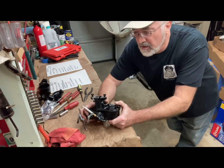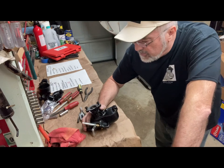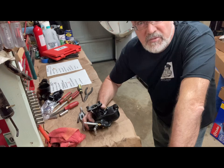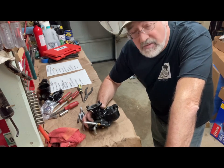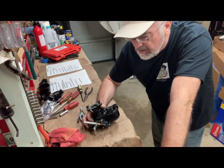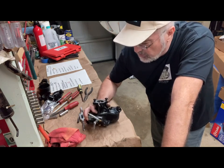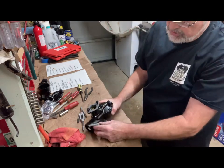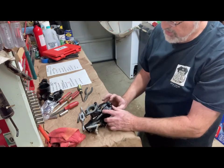And I'm still gonna work on the Holley. It has some stripped threads that I have to work on for a little bit. But you know, it's basically the same design. The only difference is it has the GAV valve seat at the bottom of the GAV, and I have to screw that in. But other than that, it's almost identical to the Zenith one. So. Next step would be, once I get the throttle shaft in and the fuel strainer in,